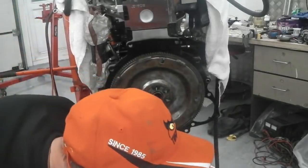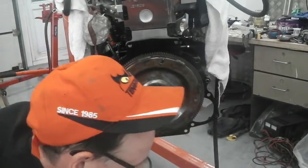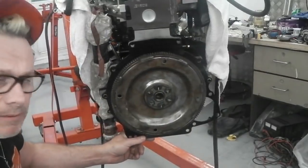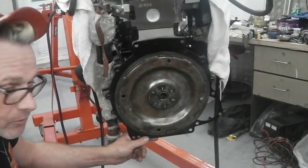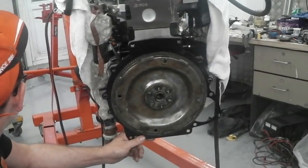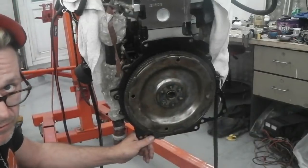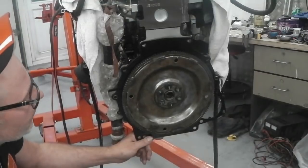What we're gonna do, a little bit different than how I did Project Ruby, because on Project Ruby I had a block and tackle and I was able to land the engine into the cradle, then put the gearbox in. This time I'm on an engine crane and it won't let me manoeuvre the dolly jig underneath the engine crane to land this into the frame. So we're going to have to lower the engine down, then bring the gearbox in this way, then we've got to get it to sit on the torque converter. It's going to be tricky. With one person, it's going to be tricky. Well, let's see what we can do.